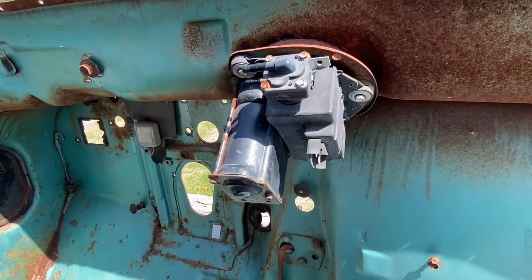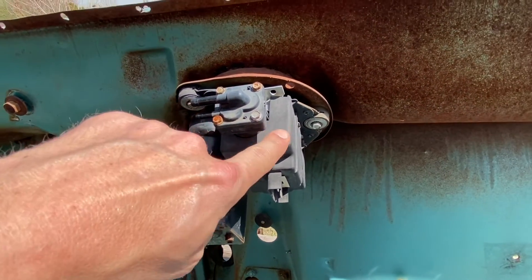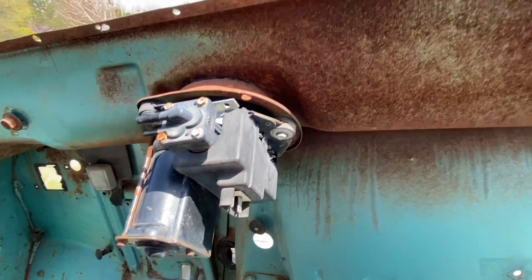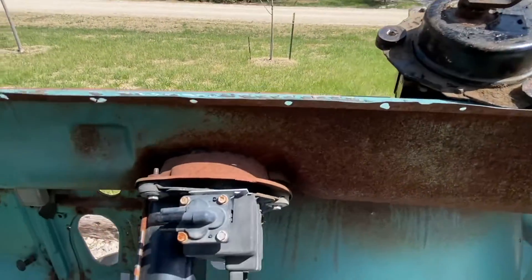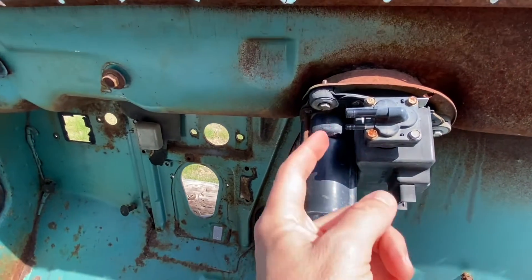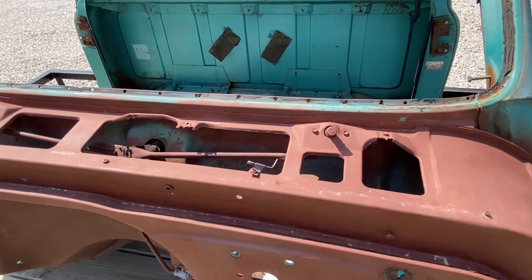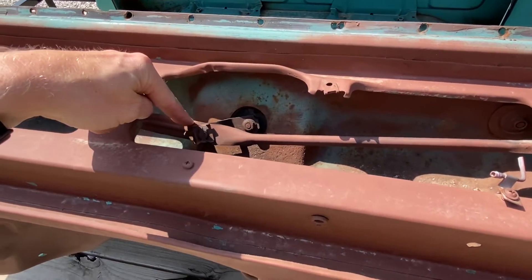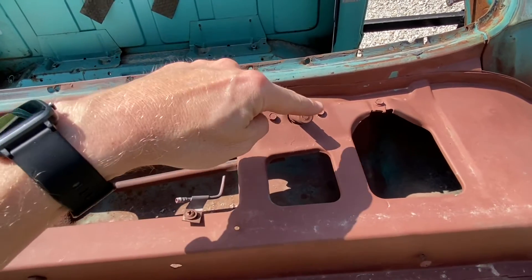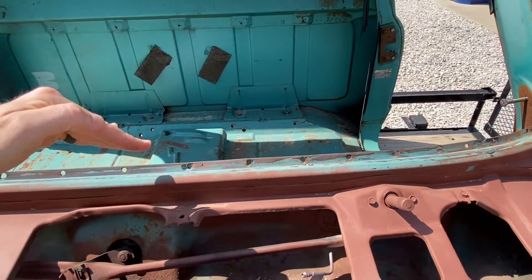The 1967 to 72 GM trucks use what they called a three terminal non-depressed rectangular motor. The metal portion is going to be the wiper motor, and the plastic portion is going to be the washer pump. The motor has three terminals and the pump has two. On the face of the motor you would have this rotating arm, and on the top of the pump you would have three ports. The bigger one is the inlet port that goes to the windshield washer fluid tank, and the two smaller ones go through the firewall and up to the squirters. As we look at the outside of the truck through the inner cowl, the rotating arm comes through the firewall and connects to the wiper transmission arms by a clip. As the motor turns on, these transmission arms move back and forth, causing the spline shafts to spin, and our wiper arms would be slid over the top of the spline shafts — that's what causes our wipers to sweep across the windshield.